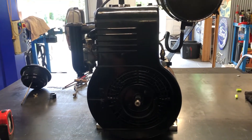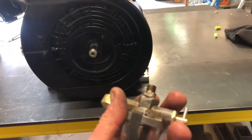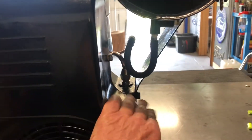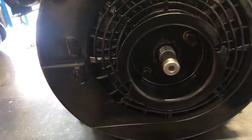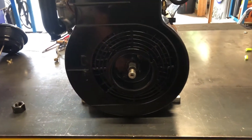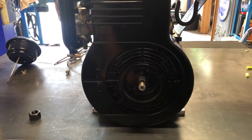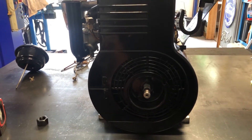Couple of issues — this bloody fuel tap is leaking like a sieve. I'll have to replace it, it's no good. I've had to jerry-rig a bit of fuel line. The flywheel nut undid — I thought I had it super tight, but I don't know how because it's got that lock on it. The flywheel came loose and it stopped going. But it was actually started on the second pull, and I just started to tune the carby a bit and then the nut came off.